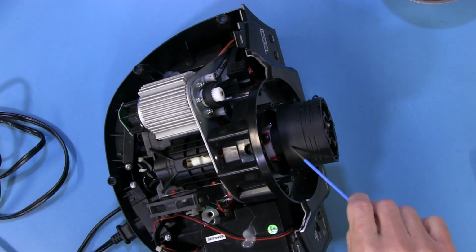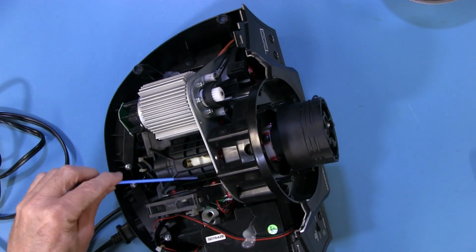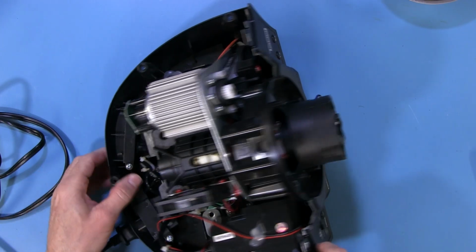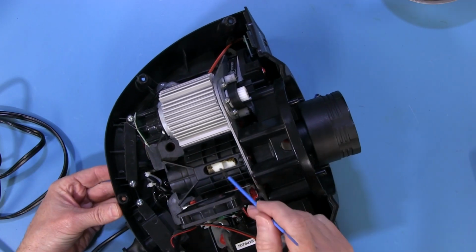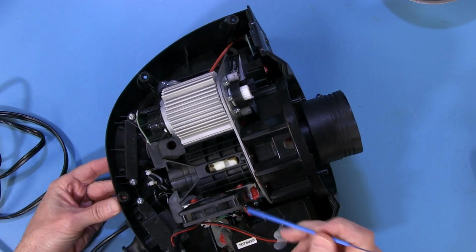And on this main shaft back in this area, there's a worm gear type of groove cut into the shaft that goes back here. And this little piece, it's kind of yellow because of the dirty grease, but it's actually white, is a kind of cam follower configuration.